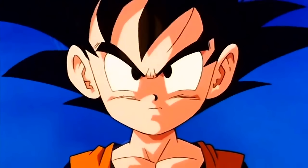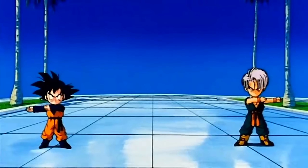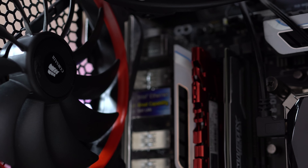So what exactly is the RAID 0 configuration? The best way I can explain it is in cartoons. You guys ever watch Dragon Ball Z? You have one Saiyan, another Saiyan, then you do the fusion dance and they fuse together and become more powerful — that's what RAID 0 is. You're going to get more read and write speeds, so it's going to be a lot faster. The only caveat is if one of them fails, all of your data is lost. That's the only downside, but I live life on the edge.